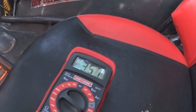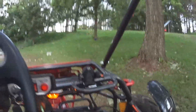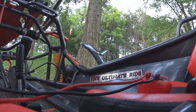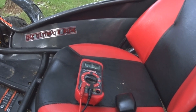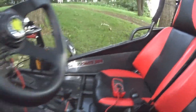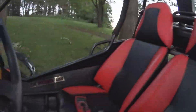Total lights, including my taillight: 3.56 amps, which is pretty good because I've got a hell of a lighting system on this thing — a lot better than stock. Stock had about 4 amps on two 35-watt halogen bulbs, which were not very bright. I've reduced my amperage and probably put 10 times the output out with that 27-watt and then two 15-watt up front, plus these little ones and my taillight.